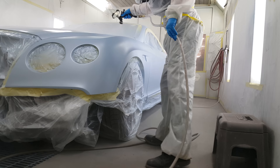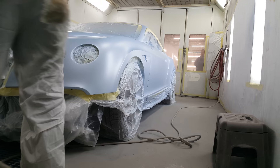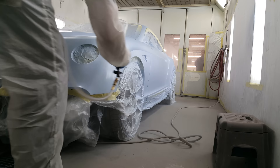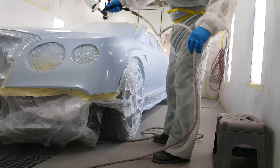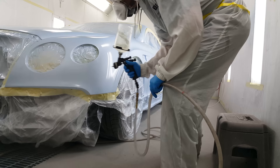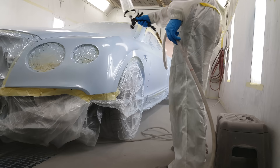We put on an extra coat of clear — three coats total — and that's going to let us sand it down and match the factory look. From the factory they sand it right down and polish it up so you've got pretty well no texture at all. That's pretty difficult to spray. I've never seen anybody lay down product without a bit of texture, especially with these low-VOC products which tend to have a little more body to them, making it tougher to lay them smooth.